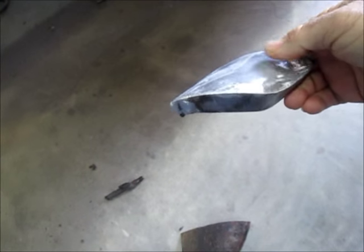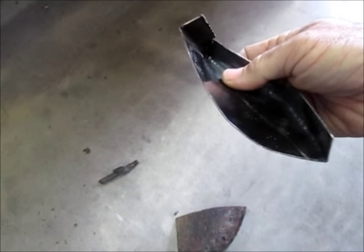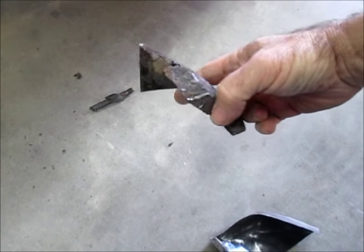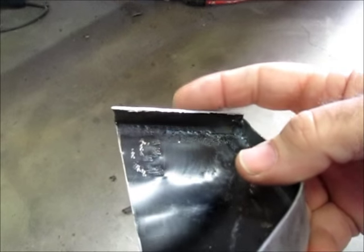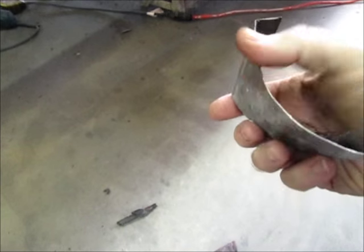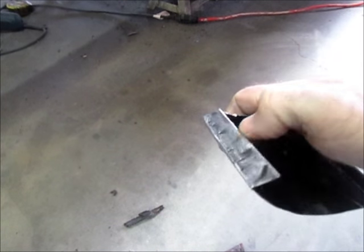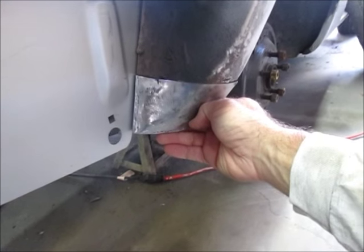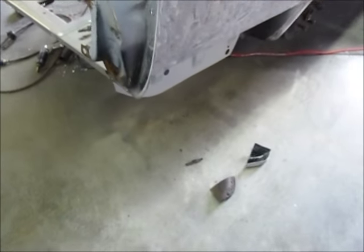I have pictures of this on my Facebook page, Joe Daddy's Garage. All I did was build this piece by piece. It's almost impossible to form that curve and this flat section and then a secondary flat section which would go against this panel. So if you can see my welds, there are three pieces - I made the curve part first, then I made this flange here, and then this flange. I'll attach that and it'll fix that outer wheelhouse.